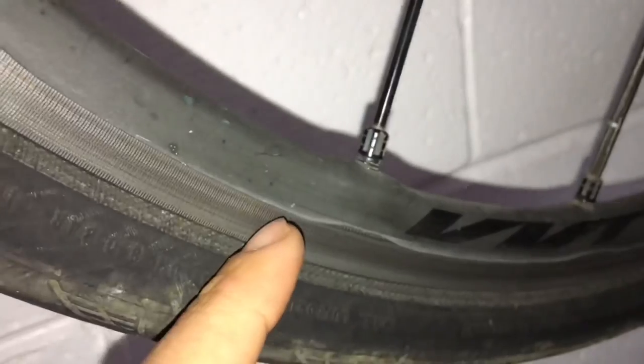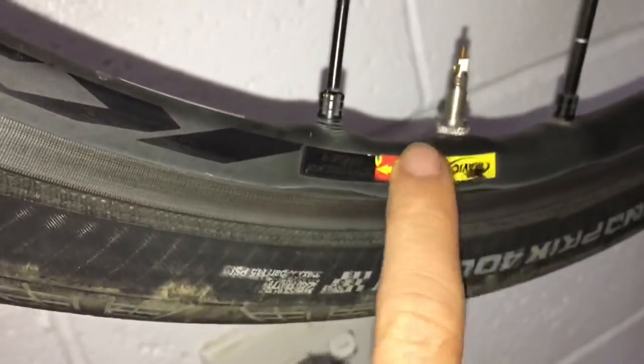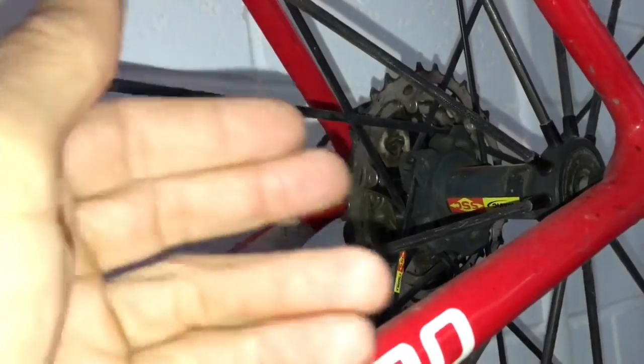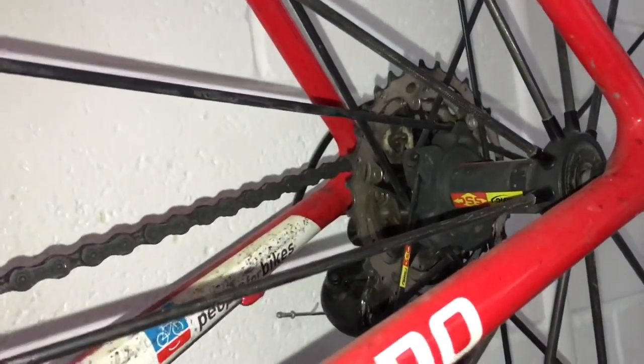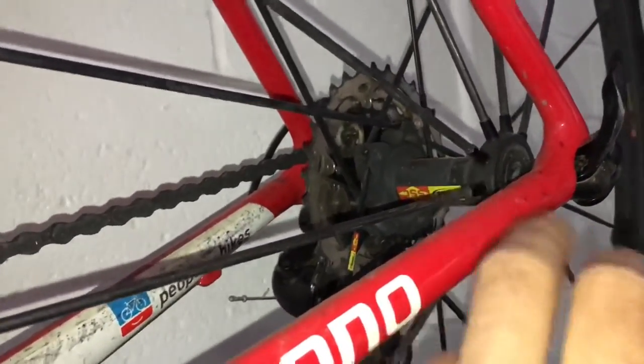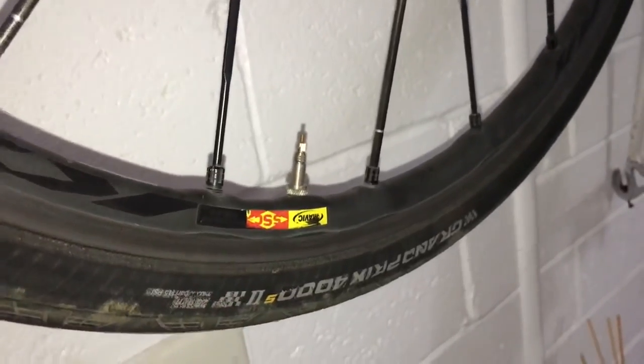Durability of the rim, poor. It's got a big, gaping hole near the eyelet there. So it's been blowing tubes. So I've got to send that back to Mavic warranty. Freehub body cassette, really sloppy from day one. Poor quality. Spokes, no breakages. Wheel hasn't been trued. Bearings good. Brake surface, excellent. Rim quality, extremely poor, potentially dangerous.